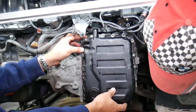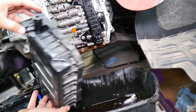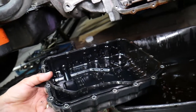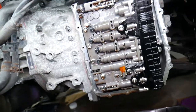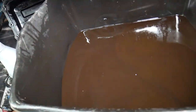Check out how much fluid came out — that's unbelievable. Here's the oil pan — you can see it has a leak. To remove the gasket, just grab and pull it out, wipe everything really well where the new gasket will contact the transmission, and replace it. Now check out the debris inside the oil pan — shiny stuff, black material. There's even a piece of something in there — that's scary.